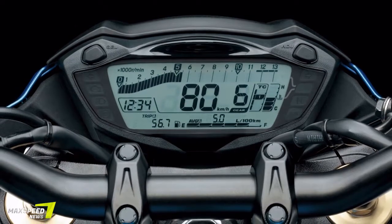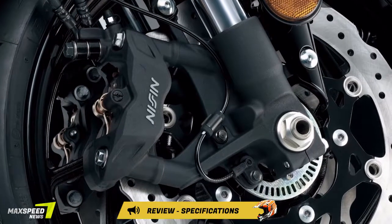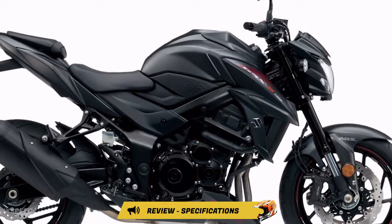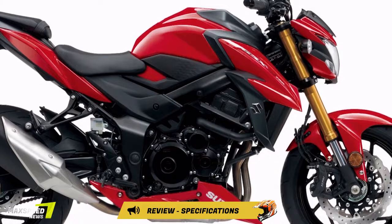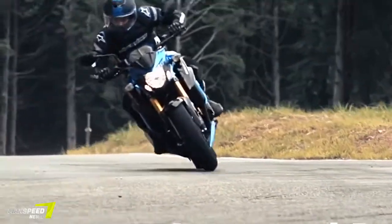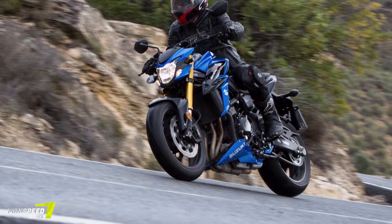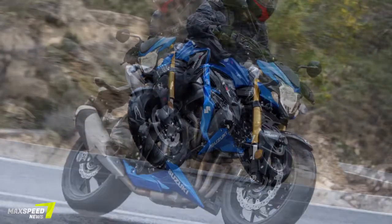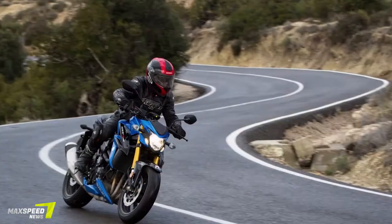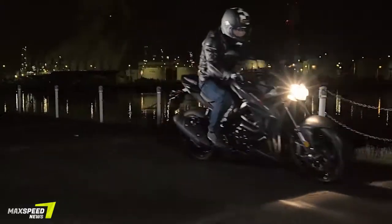Given the 749cc inline-4 is derived from that of the 2005 GSX-R750, some complain the 106-horsepower GSR 750 lacked fizz in the form of the missing 30 horsepower. For 2017, Suzuki has given us some back, with power up to 114 horsepower. Peak torque is slightly up too, from 59 lb-ft to 59.7. And Suzuki has done this while making the engine compliant with the latest Euro 4 emission limits. The rear sprocket has also been increased in size, from 42 to 43 teeth, for more aggressive acceleration.